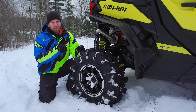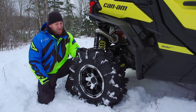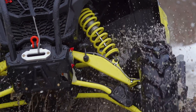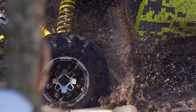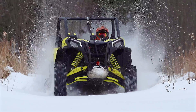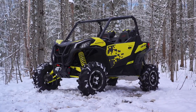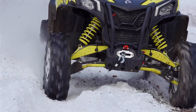The Cryptids sit at 9 inches wide up front and 11 inches wide in the rear, mounted to a really nice-looking 14-inch black and silver rim. Is 30 inches enough when it comes to the Sport XMR? The answer is both yes and no. With bigger tires and deeper lugs, will it go further? Well, yeah, for sure it will. But you'll also suffer with needing to lower the gearing to accommodate, sacrificing top speed, and possibly most importantly, suffering from on-trail harshness and lack of grip on dry terrain when you're out trail riding to get to the mud. It's my belief that the Maverick Sport XMR isn't just a one-trick pony — not just for the mud, but a very capable on-trail cruiser as well, offering a comfortable and sporty ride with the focus on getting through just about any mud hole in your path.